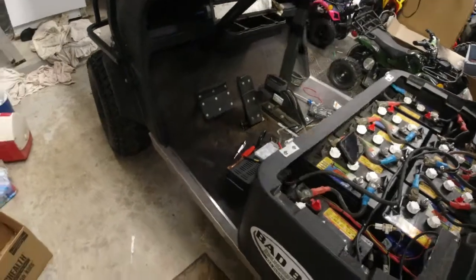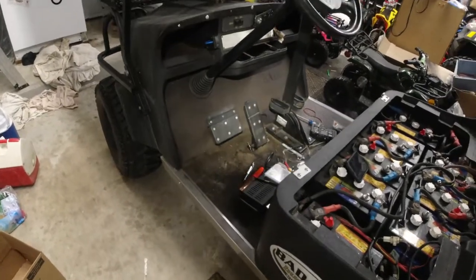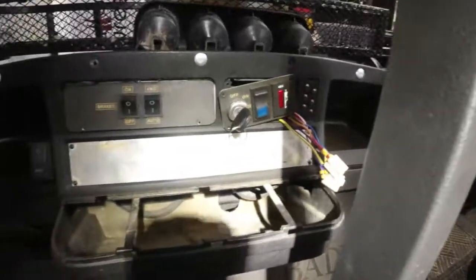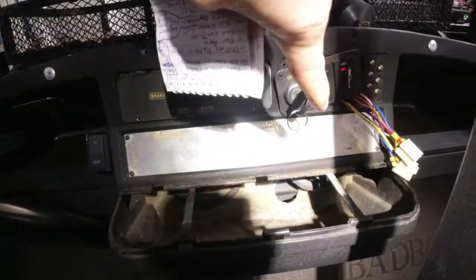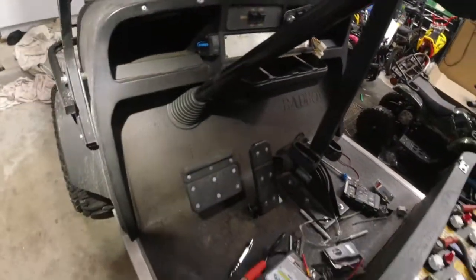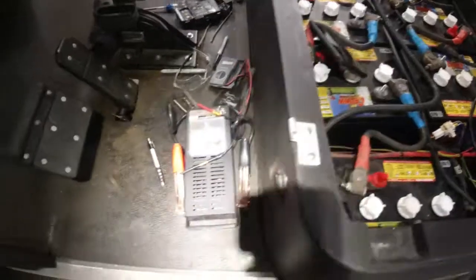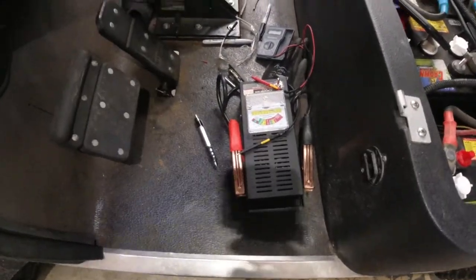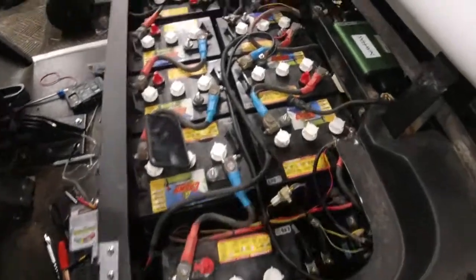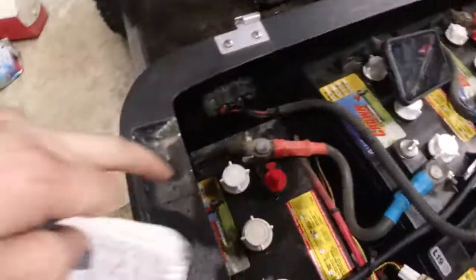Here's what I've diagnosed. When I turn the key, I do not hear the solenoid click. The dash and the electric meter work — 48 volts. This is a 4x4, all electric, no gas. The headlights do not work, the cigarette lighter does not work. I tested all the batteries individually and they're all good. I got 50 volts coming out of the main negative and main positive, and 50 volts going from B-plus to B-minus on the controller and at the back of the charging port.